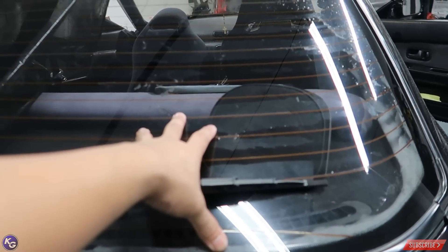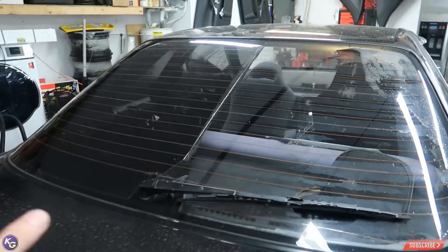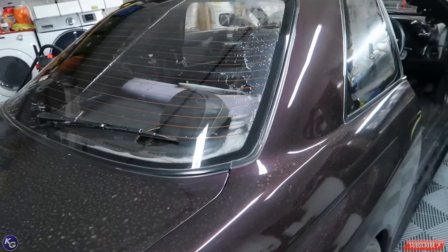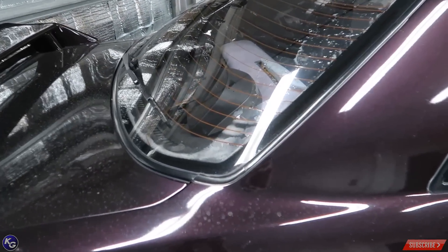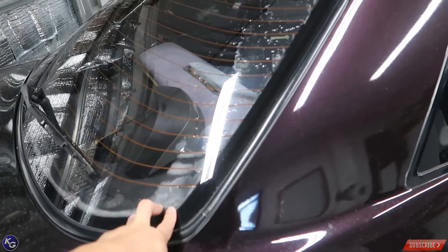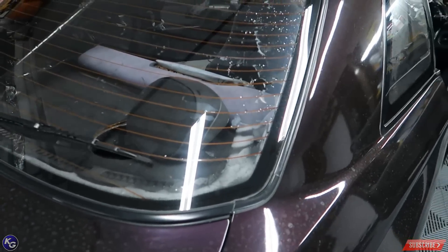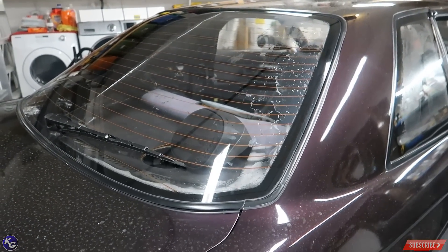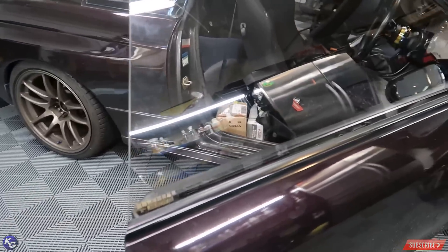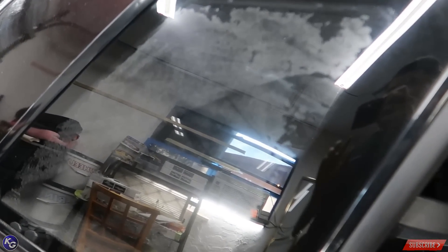From my understanding, the car was tinted, it faded and went clear, then someone was messing with the speaker and scratched the tint, and they retinted the whole thing — probably here in America. What everyone should have done is remove the old tint first and then retint it. Now I have to deal with it. Got the tint off the front glass — that was easy. The back glass has some residue I can scrape off with a razor blade.